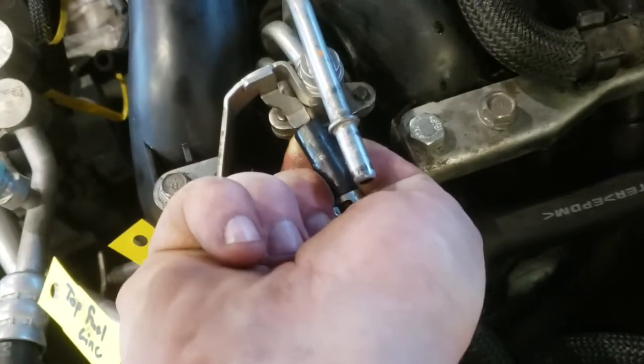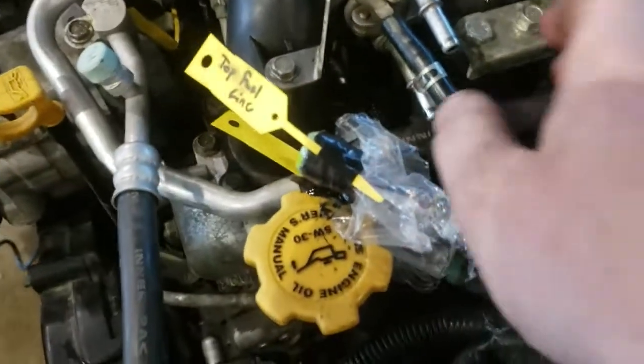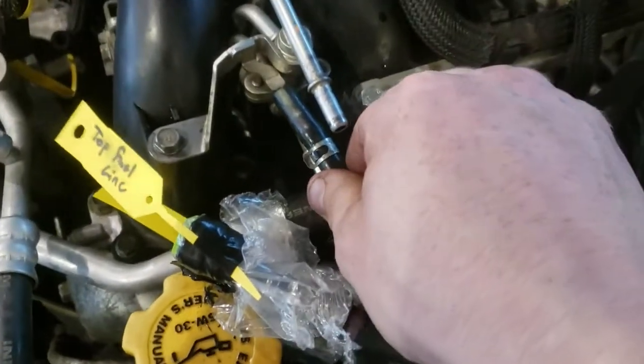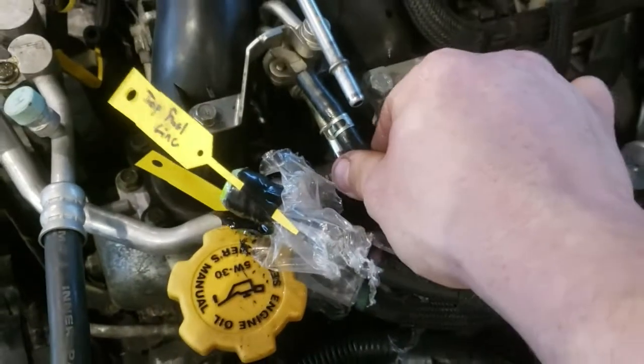Sort of. No, it's on its way. Ouch. Well, yeah, I'm gonna pull this off. I need 2 hands to do it without wrecking anything, so this is coming off as well. So the videos that I'm watching, the guy is telling me that the next thing I need to do is take the downpipe out. And in order to do that, I gotta take the turbo out, and in order to do that, I gotta take off the heat shield. So I'm gonna go and take the heat shield off.